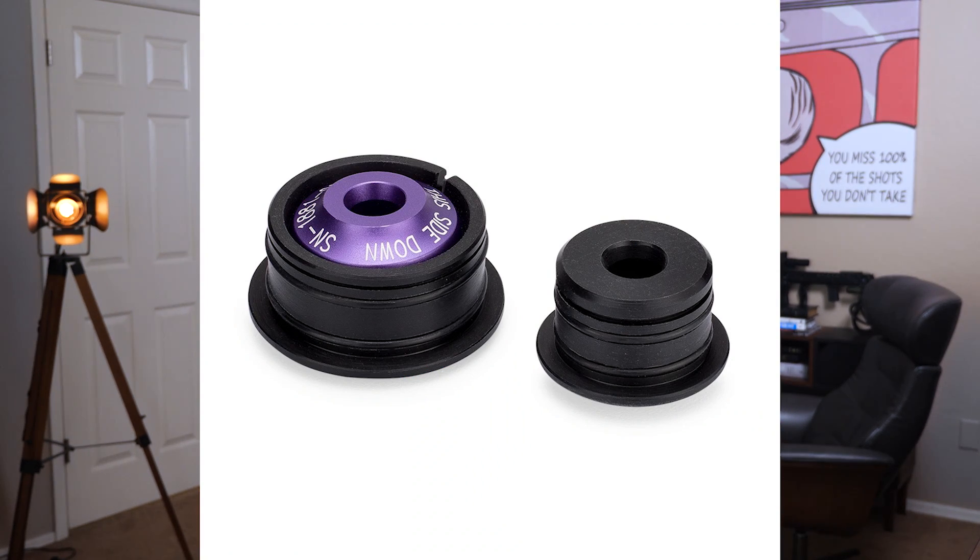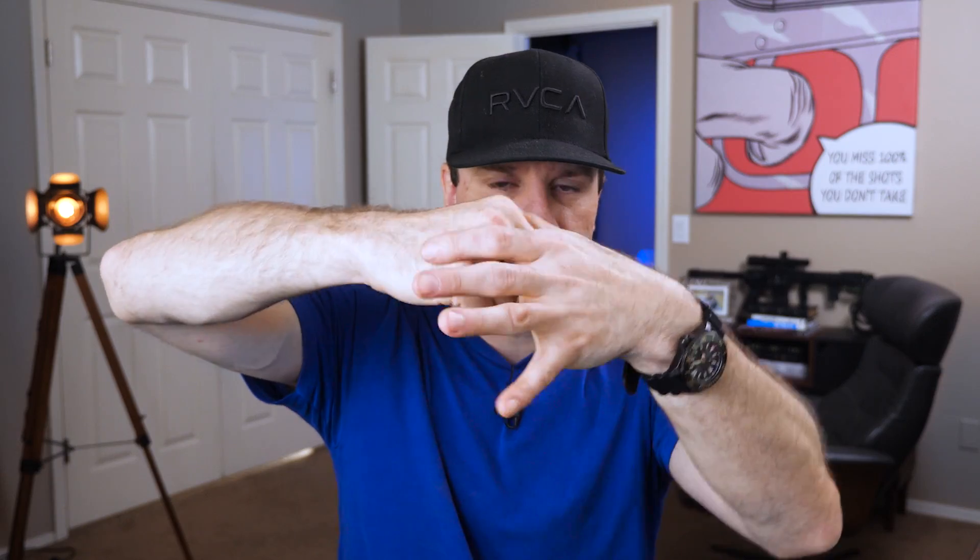Solid cable bushings are the opposite extreme, but the problem is they wear out the cable bushings because they don't allow any flex, resulting in snapped cables - which is all over the forums. Acuity's solution is spherical bushings: the center is solid but the spherical bushing allows movement in every direction. They've also added an elastomer ring, so with the elastomer ring and the spherical bushing it allows flex, but when you install them and start shifting you definitely know you're in gear - the guessing is completely eliminated.